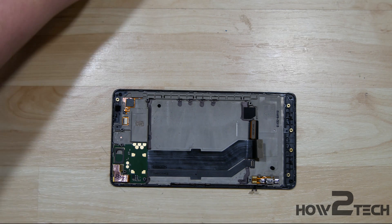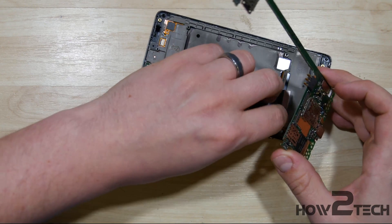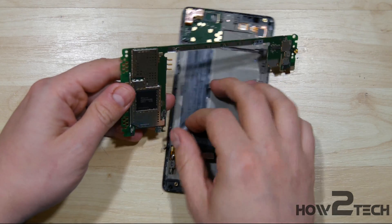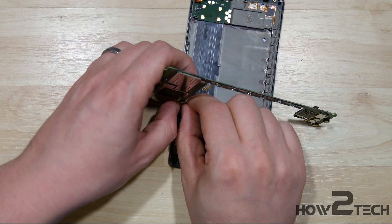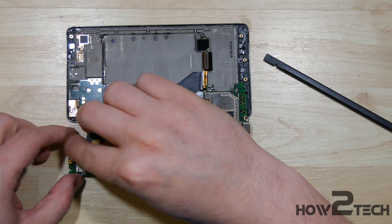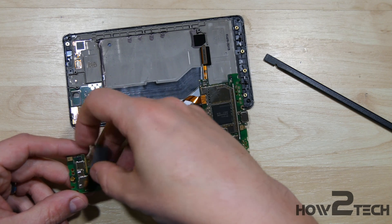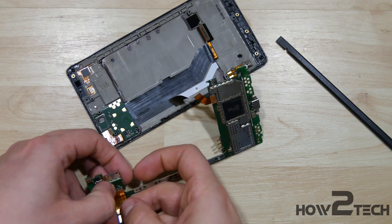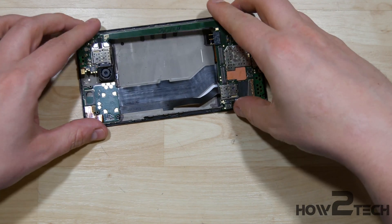Perfect, there we go. Now with that done, we can go ahead and take the entire portion of the logic board. What we can do now is snap on the connector onto the back side of the board. Feel free to fold it over — I'm just trying not to remove as much of the cable as possible. Then we'll also need to reattach the rear-facing camera. I'm going to line it up and give it a pretty gentle push. You can unfold it a little bit if you need to for how it lines up.